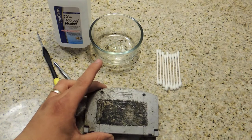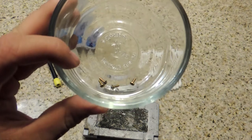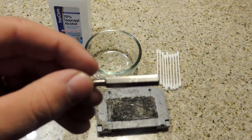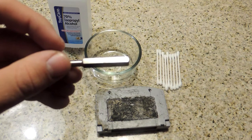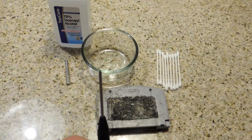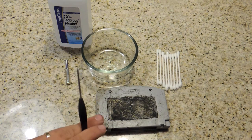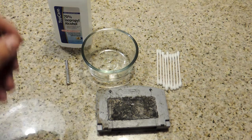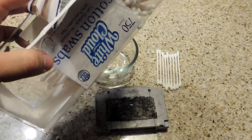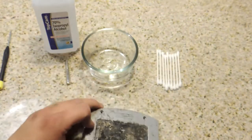Since I already made another video on how to tear it down, I'll just give you a quick overview. In my little dish here I have the two security bits that hold in the cartridge, and for that you'll need a 3.8mm security bit. You take those out, and you'll also need a small Phillips head screwdriver for the other two screws on the inside. I believe a standard size one usually works, but I found that a precision screwdriver from my kit worked very nicely. The other thing you'll need is plenty of cotton swabs — I have a few here, but also this giant container, because this is going to take more than a few to buff that out.